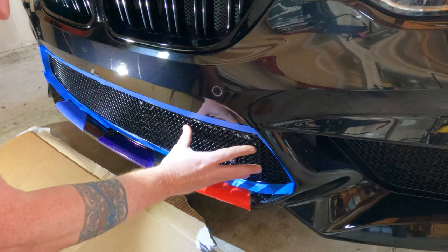The other thing I'm going to do before I tighten this down into place is take my painter's tape off now, because if there's any tape that'll be trapped back behind — and this lower edge is definitely going to be trapped — I still have some flexibility to move this around and it's not going to hurt my paint. I can get this off without pinning any tape back behind this grille. I would suggest you do the same. Get all your painter's tape off, then reach through, find all your little tabs, secure them by bending them back so they apply a little more positive pressure and get a better anchor, and then you're all done.